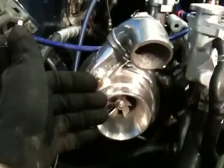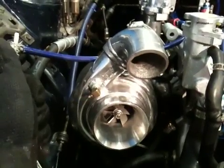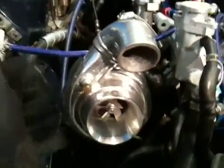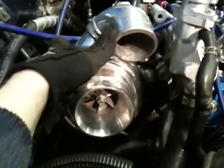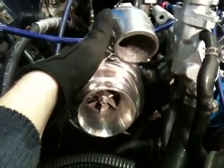If you choose too big of a turbocharger, it's like blowing on a windmill — it's going to work really efficiently at the high end, but that's where people talk about lag, where it takes forever for this little guy to start spinning as fast as you need it. Hopefully that's a little insight into the different size turbochargers and why to pick them.